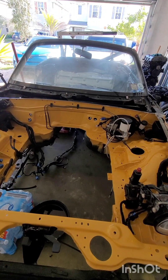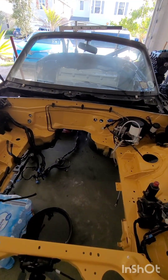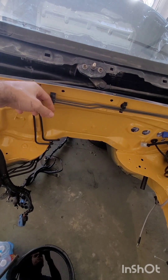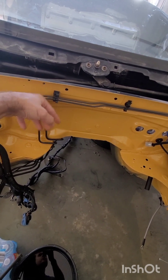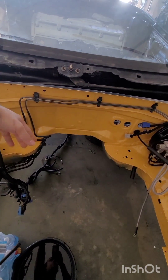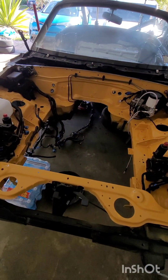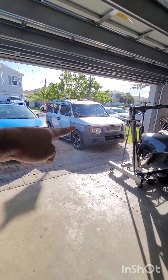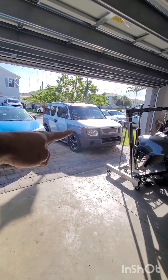That's why I'm going to go with a COP kit instead of going back to the conventional coil pack, which takes up a lot of space. That way when I go to service the thermostat or do the coolant reroute, it'll be a little bit easier and I'll have more hand space instead of being all cramped up.